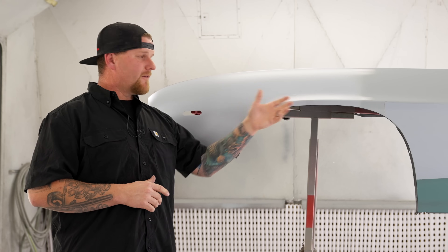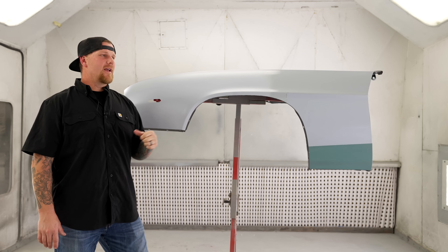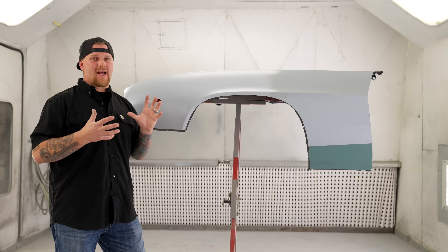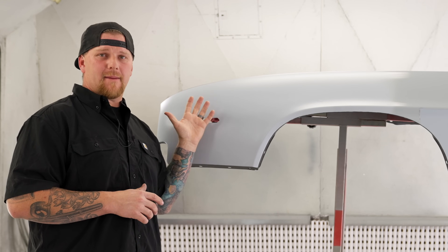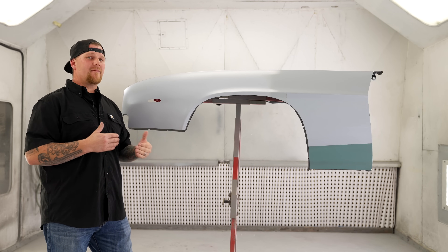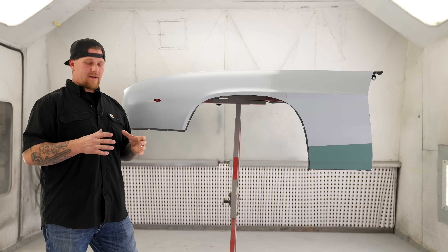You can use body filler right over epoxy, or you can go to polyester, which is sprayable body filler form. Polyester is not typically sprayed directly over bare metal. These days they have primers like Claussen's that sells a DTM polyester — I've looked at the technical data sheet, and there are high-end shops using it with great results, but I don't feel it will have as good a result as the VP-2050. If spraying over a bare metal car, you want to make sure it's not just a porous surface where everything can soak in. There is also a lot of shrinkage with polyester, and the amount of shrinkage with VP-2050 is minimal by comparison.